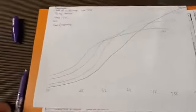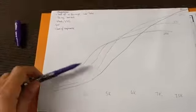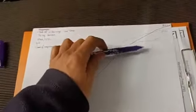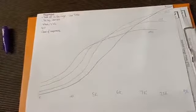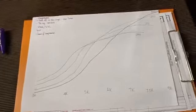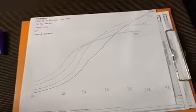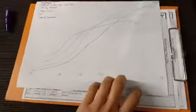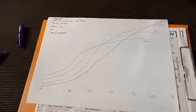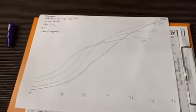So the typical thing is, I look at what I'm giving away as I go bigger in cams. Am I making that up top? What's the compromise and balance that I'm after for a given engine? And that's the decision that you guys will have to make. What's right for you? What are you chasing out of the engine? How many revs can your engine turn? What are you looking at doing? No two camshafts are going to be perfect for two different people with two different goals. So you've just got to pick the weapon to suit the fight, I guess.